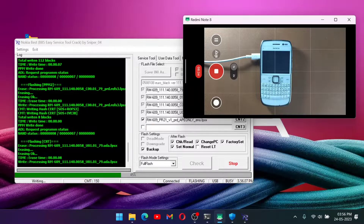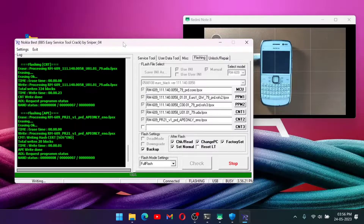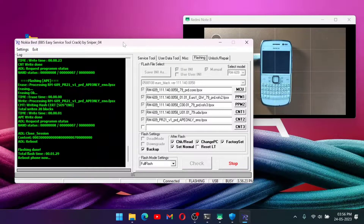When I flashed my Nokia 6300 it took about nine minutes even for just PPM only, so time can vary. I will show that firmware in another video. Be mindful about these things — don't do this on your regular phone, do it on a spare phone.